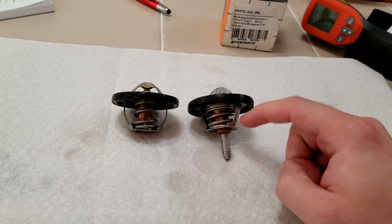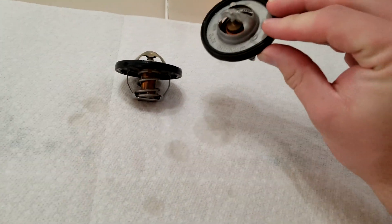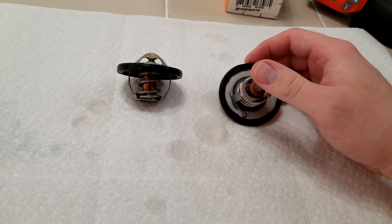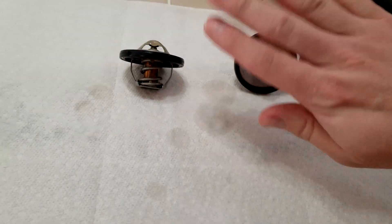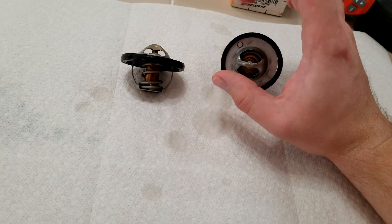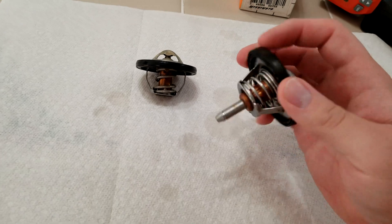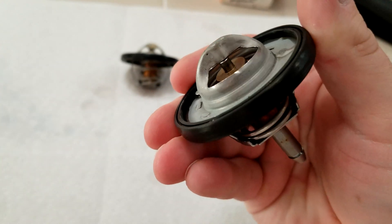The answer is actually this tail. This tail is actually so long that even though the thermostat is capable of opening much further than an OEM thermostat, it can't — because this tail contacts the back of the engine, basically — or more specifically, the timing chain cover that this sits in. In the front, you have your thermostat housing with the lower radiator hose and the two bolts holding it on. So the answer is not actually the aperture, which was my expectation. The answer is this tail. As you can see, it has not fit back into place properly.